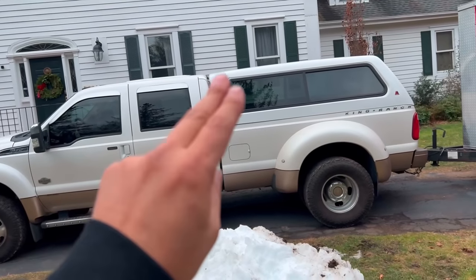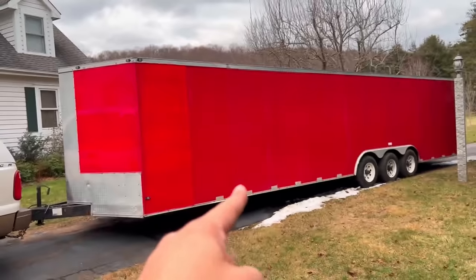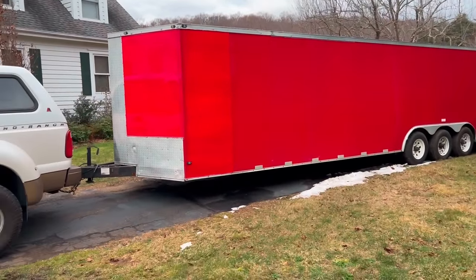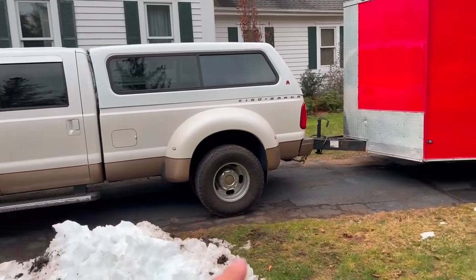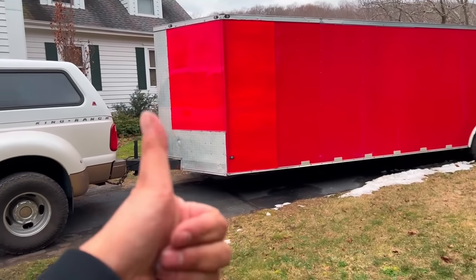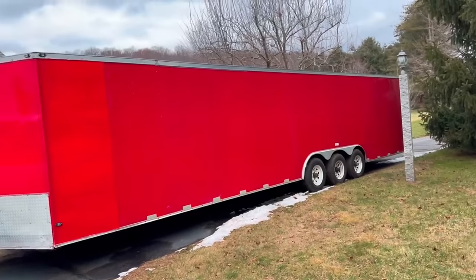Back on the GVWR — the truck is 13,300 pounds GVWR and the trailer is around 12,000, so we're literally about 700 pounds under the 26,000 limit. You don't have to worry about what's in it — it's literally just those two tags. If the cops pull you over they check them, and if you're under you're all sweet — no CDL commercial driver's license needed.